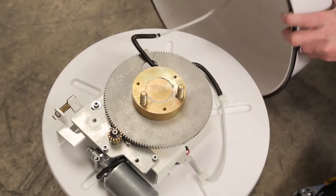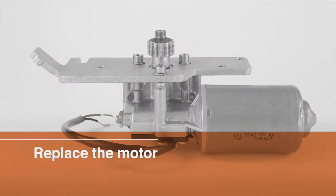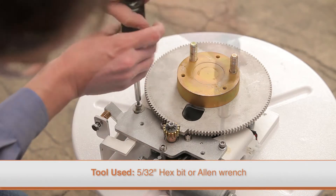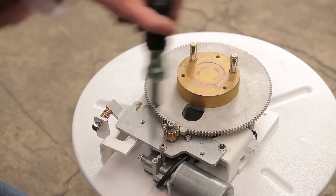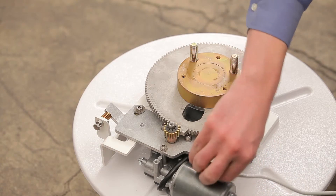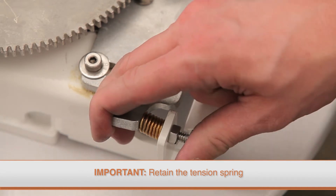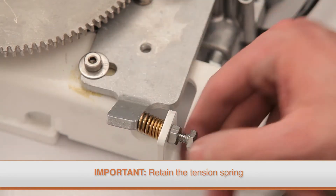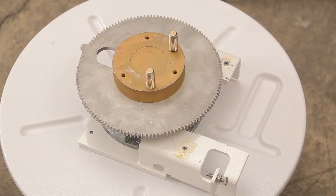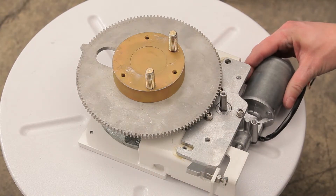Thread the cable through the opening in the lift cover, then replace the cover on the lift. To replace the motor assembly, remove the two mounting screws using a hex bit driver or Allen wrench. Make sure to loosen the screws on the terminal block that secure the motor cord and remove the cord from the block before removing the motor assembly. When removing the motor assembly, make sure to retain the tension spring that fits between the motor assembly plate and the base frame. This spring will need to be reinstalled with the new motor assembly. When replacing the assembly, simply align the holes in the motor assembly mounting plate with the holes in the base, insert the screws and tighten.